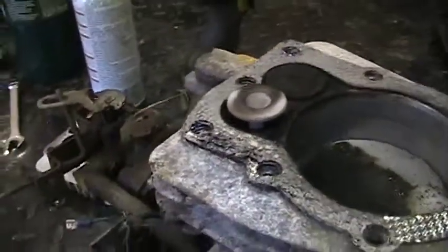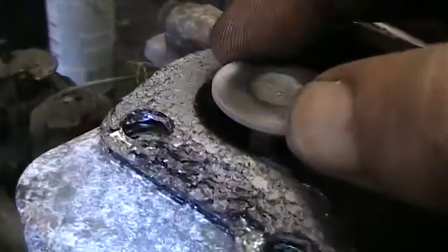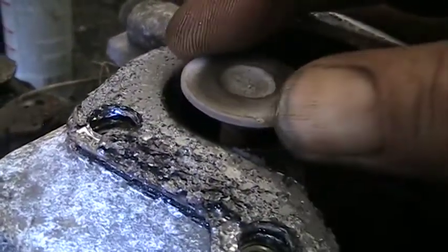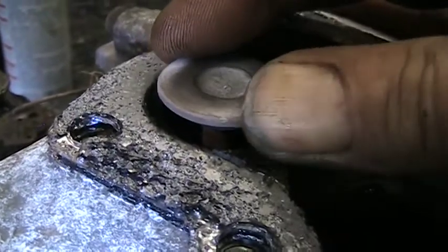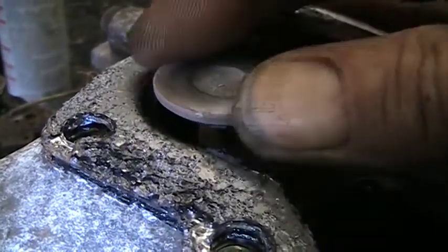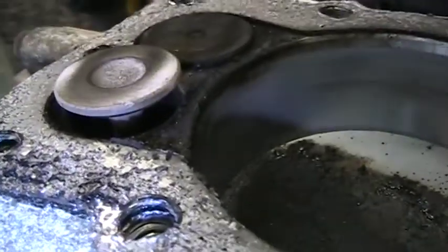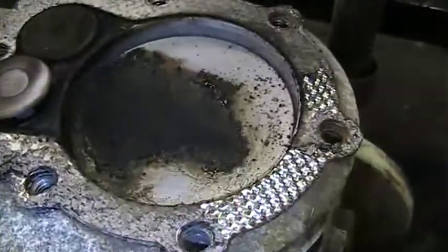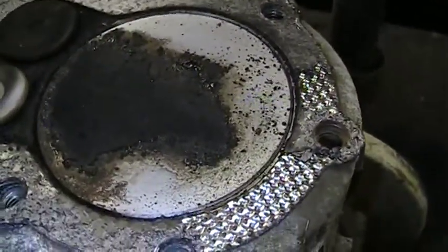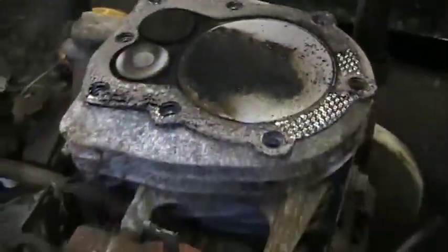So, exhaust valve is open. Let's see if I can get a picture of it. Now wobble. Engine, she's toast. Toast. The guide, she no good. Well, that sucks. I thought it might have been a decent little project here, but sadly, she no go.